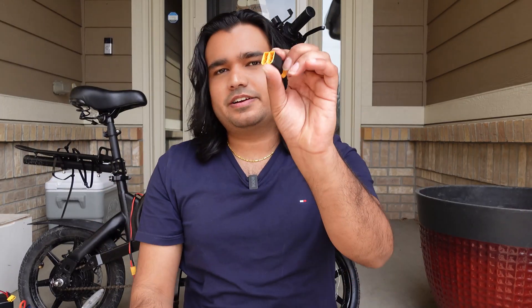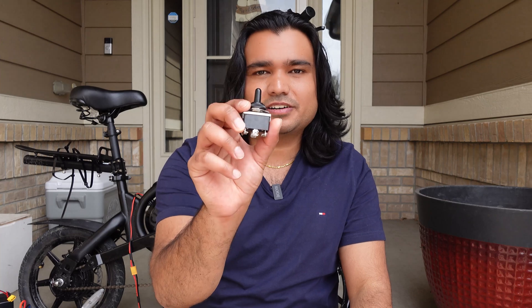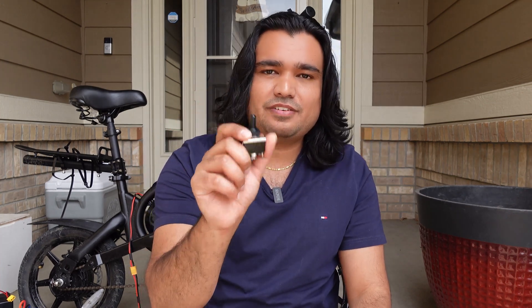That will do it for today's video. Here's the switch and here's the parallel connection. I told you about my concerns with parallel connection — this switch method is my preferred approach. It doesn't take much real estate on your bike but provides great value. It's safer: you don't have to worry about charging both batteries or maintaining them at the same voltage. You can charge them individually anytime. I highly recommend this method. If you have any questions about wiring or anything else, please let me know in the comments and I'll help you out. You can also reach me by email or Instagram.